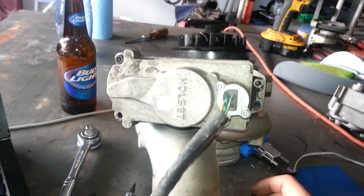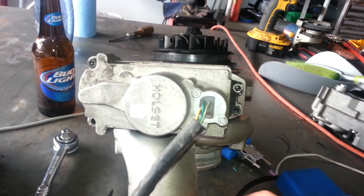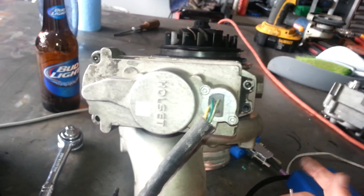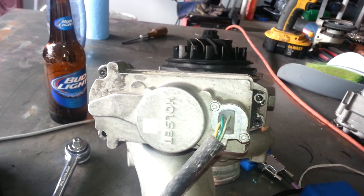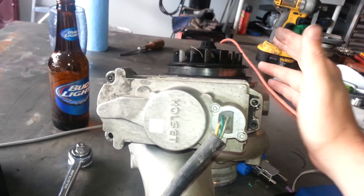It would jump. So basically you'd have, let's say, starting out at 9 centimeters. Once you hit like 10–15 pounds of boost, it would jump to 12 centimeters. And then once you hit 15–20 pounds, it would open up a little bit further. So my problem was with that setup, it wasn't really linear, and it didn't cause a fluid motion.